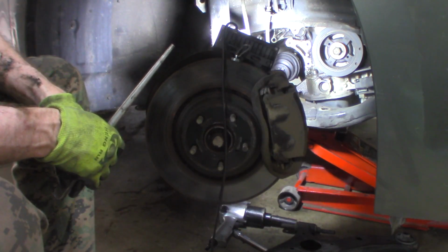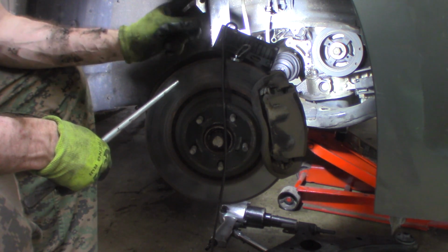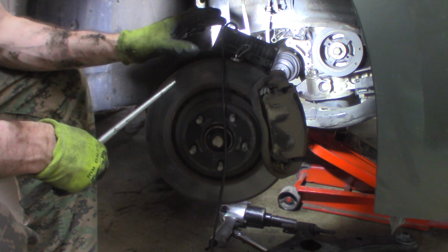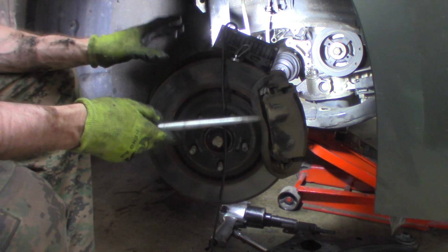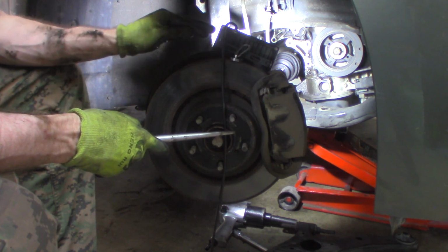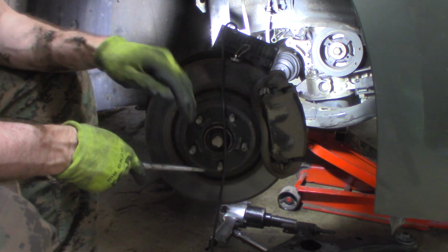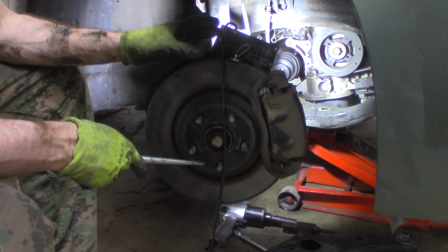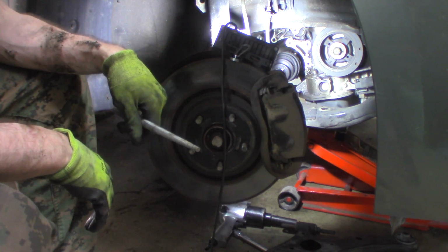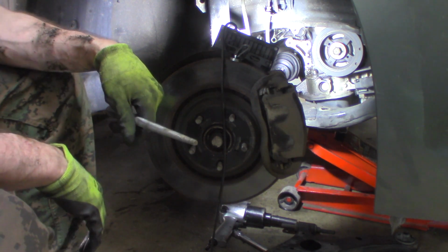One thing I didn't mention in the beginning is I did rotate the tires and had an alignment done on this, because I thought the alignment had been done and it hadn't been, so I went and got it done. You've got to do that first to make sure you don't have an imbalanced tire or the alignment's out, when I couldn't really find anything else. Just checking the obvious. It didn't look great, but no play really. You want to do that first and make sure that you don't have a bad, out of balance tire, a tire that has a bad cord or something causing an issue, or you're out of alignment, and that can cause a problem. So I did that first, and we'll come back after I talk to my friend, and we'll probably do control arms and see what else he wants to do in here, and we'll go from there.